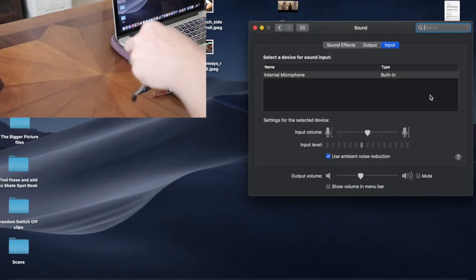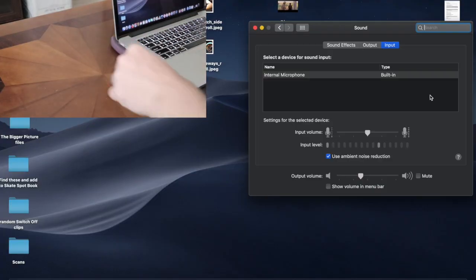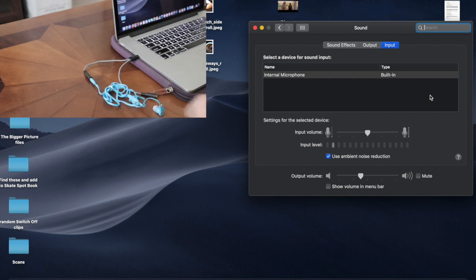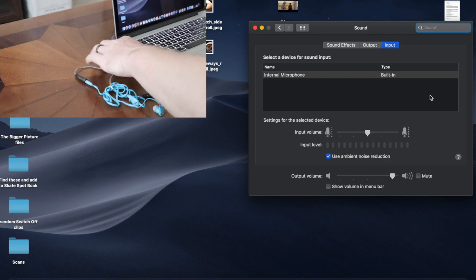The trick is: take your audio splitter and plug in your external headphones. I just have very basic, generic headphones from the 99 cent store — ones that have a microphone built into them. You want headphones that actually have a mic built in. You plug them into one split on the headphone jack, but because my computer needs a tip, ring, ring, sleeve configuration, it still shows built-in audio for the input.